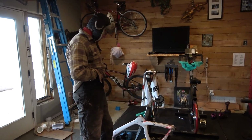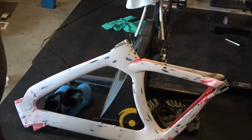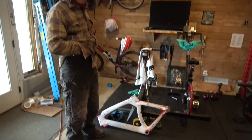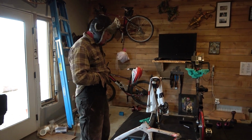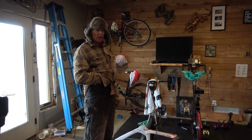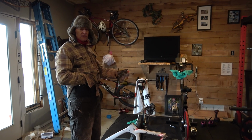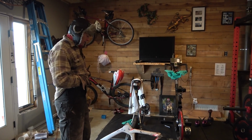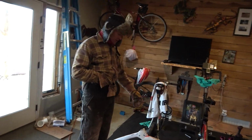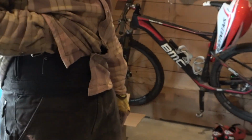How many more hours do you estimate you've got? I see some gray coloring coming through. Are you down to the primer? Getting down to the primer? Yeah. Once I get the epoxy off, it'll be a lot easier to hand sand. Do you have to get it all the way gray? It would be better. It would avoid orange peeling and stuff. Because when you spray your new paint on, it can dissolve the old paint and make it look like crap. Well, I think if I at least get the majority, because I don't want to add weight to it as well.